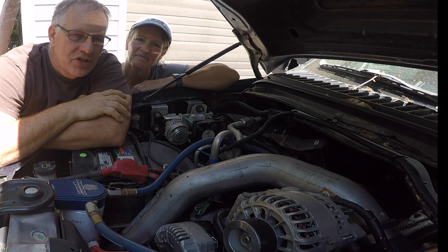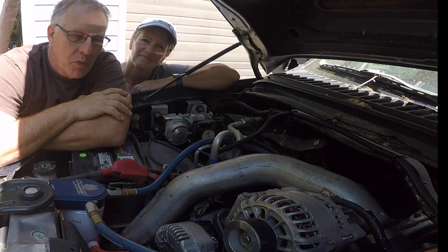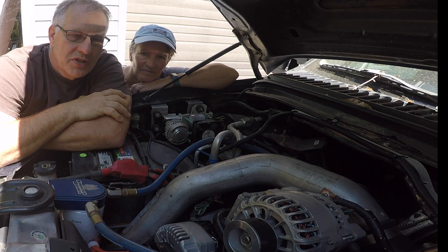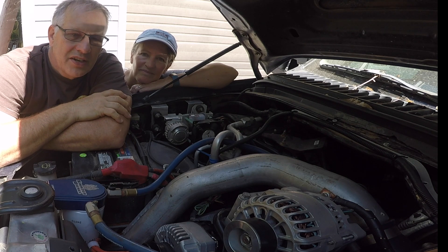If you really want to accomplish quite a bit of charging, you need one of three solutions. Solution one: increase your alternator size slightly and use a DC-to-DC charger. Option two: upgrade your vehicle to use dual alternators charging in the same common 12-volt system, then use several DC-to-DC chargers. Option three, which I prefer, is to install a second alternator as a dedicated camper charging unit with a charging regulator — no DC-to-DC converters needed.